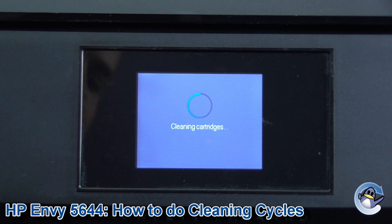Now ink comes directly from the bottom of the HP 62 ink cartridges used by this printer, so these are what you are cleaning when you're running through this process. Print quality issues are much more likely to be the result of dried or congealed ink on the bottom of the cartridges. This process just forces fresh ink into the printhead to try and dislodge any dried ink, and as a result it will affect the estimated ink level of your cartridges. But if they're not printing well anyway, you're not really losing out.